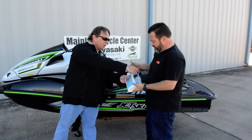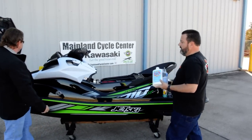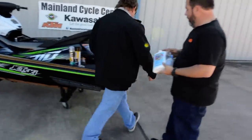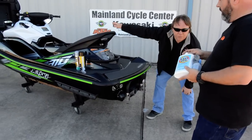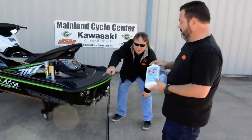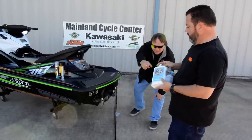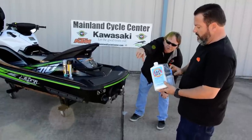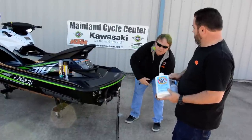It's got an open and close on top. So basically you hook this to your fill — these are on the back. You can literally hook this to your garden hose and run it through the jet ski. Of course you want to fire your ski up first, get it going, turn on your water. Once the water starts coming out the back and out of your side, you'll feed this by turning it, just like your garden feeder, and it'll start flushing the salt away.